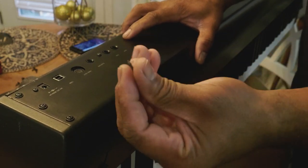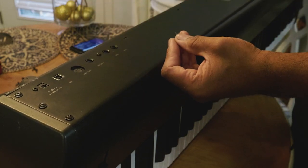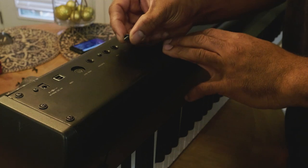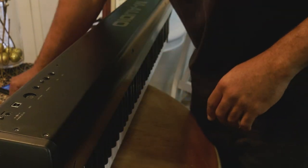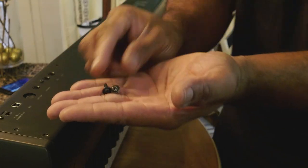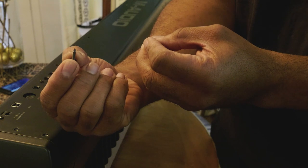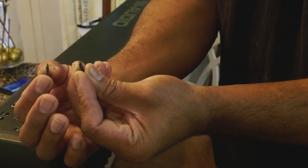There are six wood screws total — one, two, three, four, five, six. Let me clarify the difference between screws and bolts: the pointy-tipped one is a wood screw — it goes directly into the wood inside the keyboard, which you can see as the tan-colored material. The other one is a bolt — it goes into the aluminum. These six are on the side of the unit.